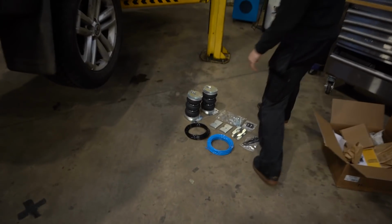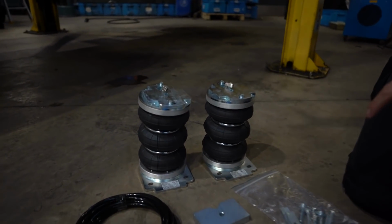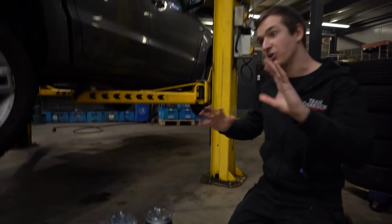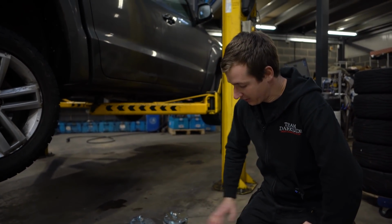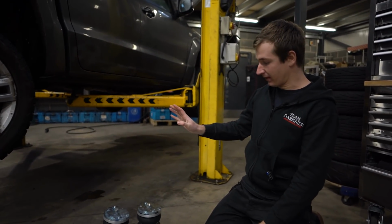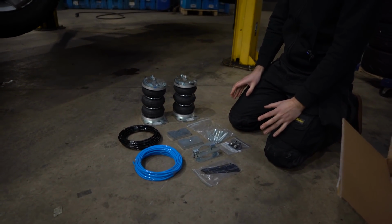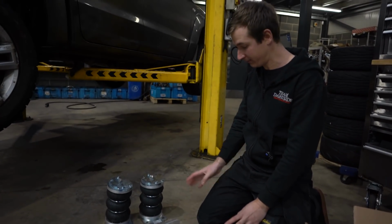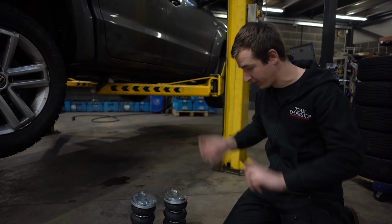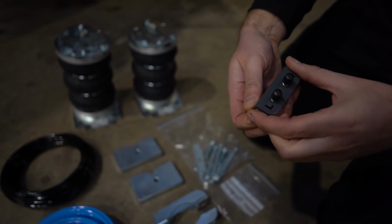To increase the rear carrying capacity, especially when you're towing, obviously you're adding a ton pretty much to the back wheels, or at least you're asking the back end to do the work of another 1,000 kilos. You need to add some airbag assisters. This is probably the cheapest kit that you're going to get type approved, which is what we need to do to get this done properly. This is a full TUV certified kit, but the reason it's cheaper is because the control system is literally just left, right.